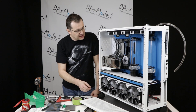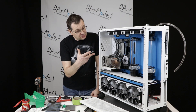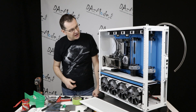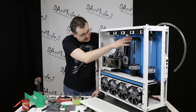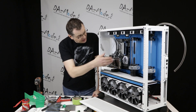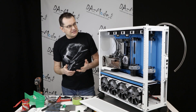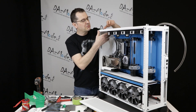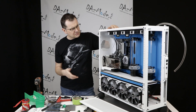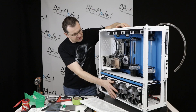I also used what I had in stock for the Singularity reservoir and pump combos. The only tubes I had were 150mm versions, and we upgraded to 250mm — that's the only longer tube I had. This created a little trouble because it's a little bit too tall. The pump is basically almost sitting on the bottom of the mid-panel, leaving almost no space. I wanted to use an EK or Black Ice radiator, but essentially I had to go with a Darkside slim radiator here because I was getting too close to the fans and didn't want to lose clearance for fittings.